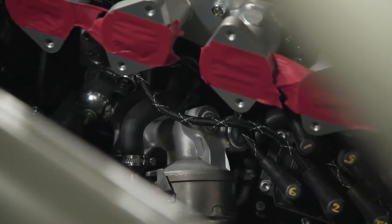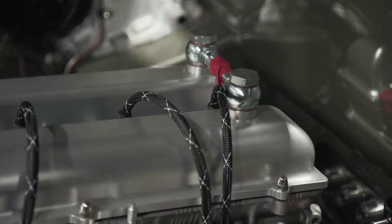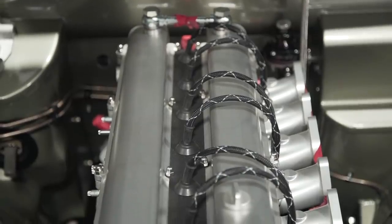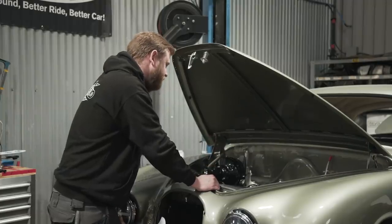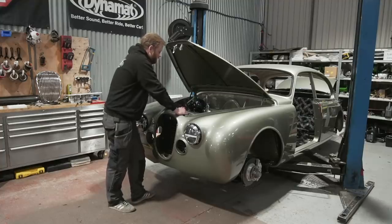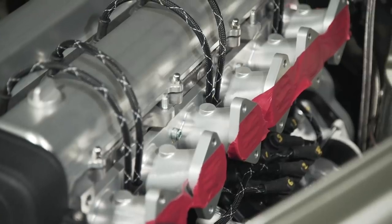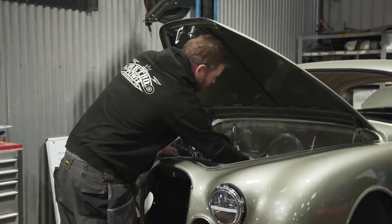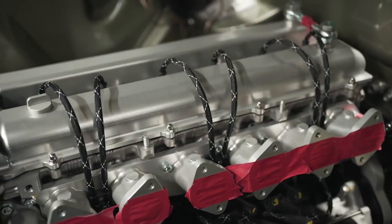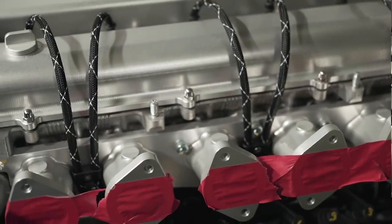We're running a coil pack down here feeding up via spark plug wires which are traditional silicone plug leads, over-braided with woven nylon braiding. They pass down through rubber grommets in a little plate in the valley, which we plasma cut from sheet steel, and then feed down to the spark plugs below. We took inspiration from the Ford BDA, which has a similar look with plug leads coming through rubber grommets in a flat plate, coming over in pairs. We also put a threaded hole between every other pair of runners on the inlet manifold so little clips hold them in pairs as they run down - a really neat installation.